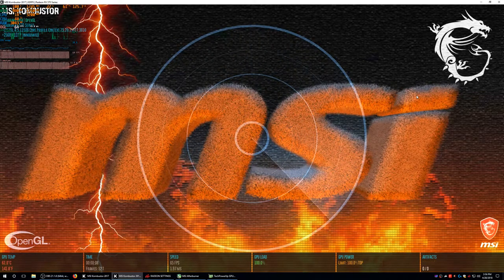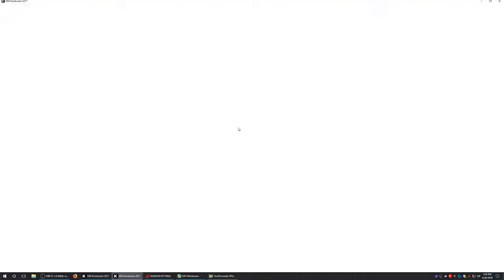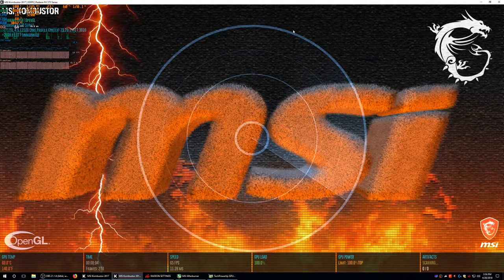Lost another 5 watts — 123 instead of 127 or 130. And we're not getting artifacts right away. This leads me to believe that when I underclock to 1245, I could probably go lower. If I'm not getting it right away, let's go to 940 mV. When underclocked I can definitely probably run this a little lower.